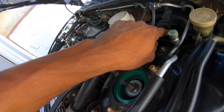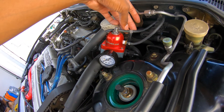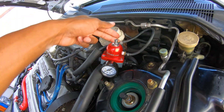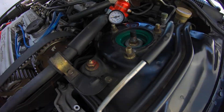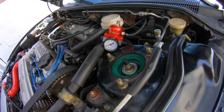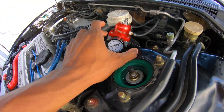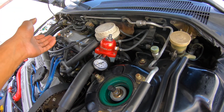So I took it off the solenoid — I have a T fitting where one line goes to the boost gauge and now the other goes to the manifold. Also my fuel pressure was too high, sitting close to 50 PSI, so I loosened the lock nut and adjusted it down to around 42.5. If you guys install this on a 2G DSM, make sure you do it this way so your car runs right. Now it starts up on the first crank.